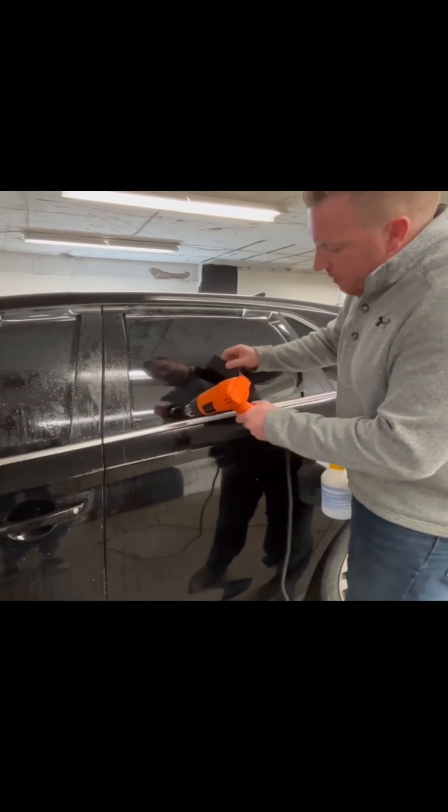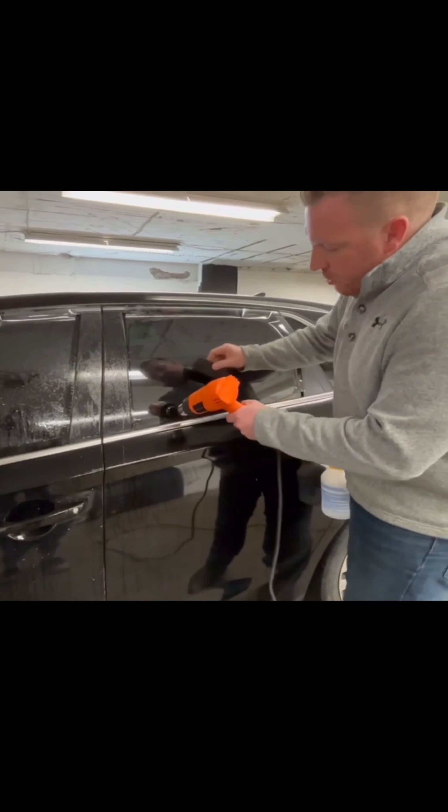The first method is called a wet shrink with the letter N. With this piece of film I'm going to spray underneath, lay my film, and leave about an inch gap on each side. Once I make that setup I'm going to tack that in and come across the top and tack that in — creating the letter N. Then I'll do a light squeegee down to get all that excess slip solution out.